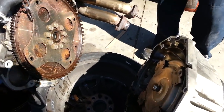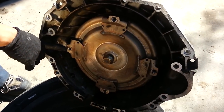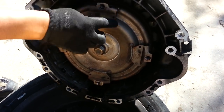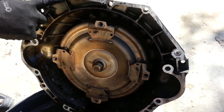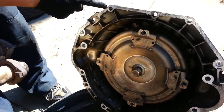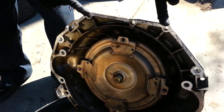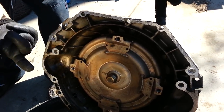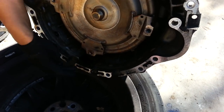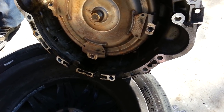Come around here — these are the 17mm bolts. You've got to go through the back: one, two, three, four. Then you've got these all around the bell housing that you have to remove. The ones up top are the hardest because you can't see them from below. Most people also miss the ones down here, but those are easy to get.